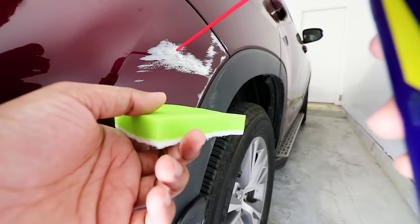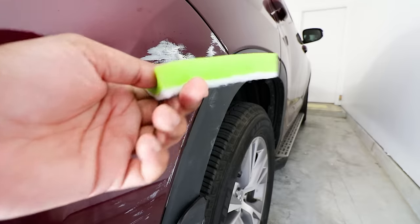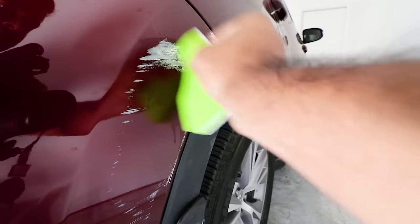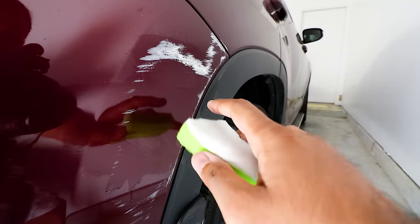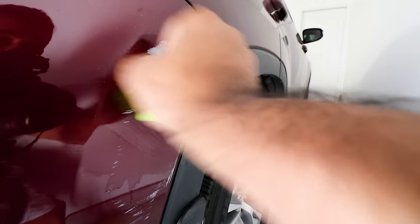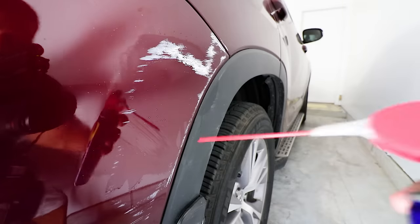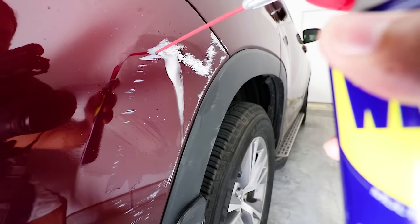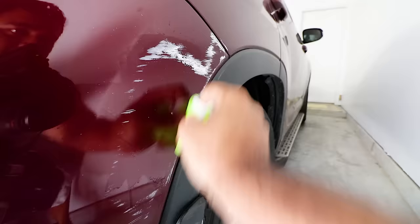So basically I'm just gonna apply some of this WD-40 on here. Let's try to get it on the actual paint itself and kind of just go with the grain and take it off. And you can already see, once it's saturated in there — keep the WD-40 on there for a little bit — it comes off fairly easy. It will take some elbow grease, but it should come up pretty simple. Be very liberal with the WD-40, just get it in there saturated into the actual paint transfer, and go to town.